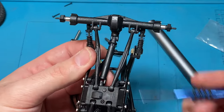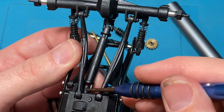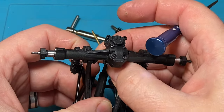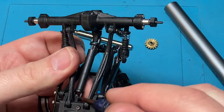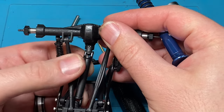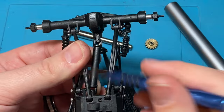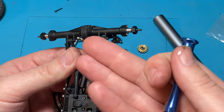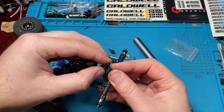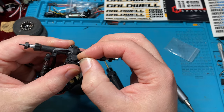So you can see like this, I've got this ear here on top, and then the ears here are on the side on the inner shaft, and then the outer shafts, this one's on top and these are on the side. That's not good. You want them to be in line with each other. Boom, boom. And then also, another way to tell is your screws are facing the same direction, right? Screw on the bottom, or facing us. Screw facing us. That means they're going to be in phase. All right, so once they're in phase, we'll go ahead and throw our rear truss back on and get our screws in.